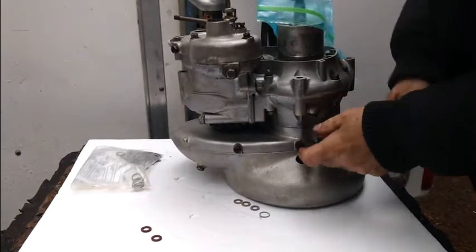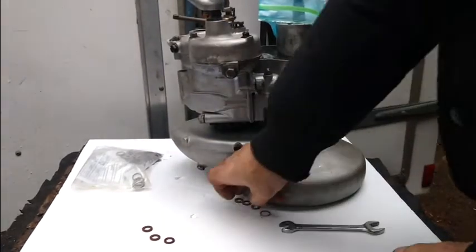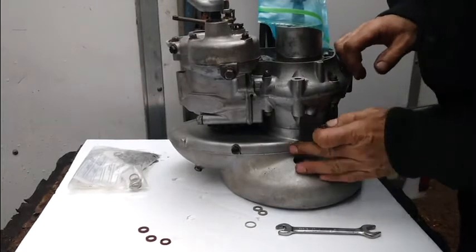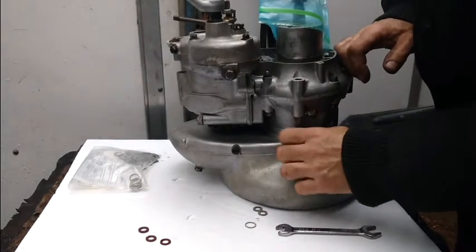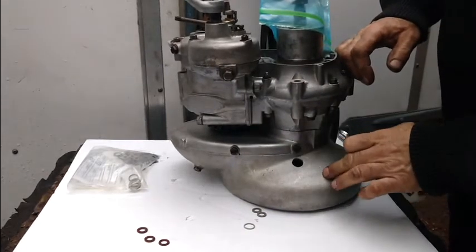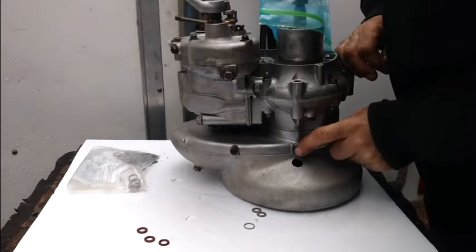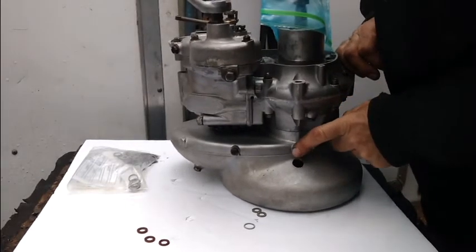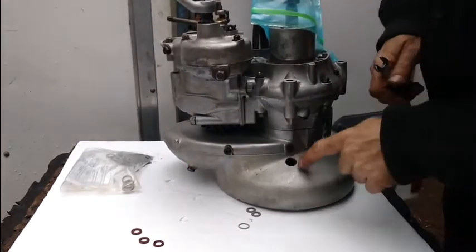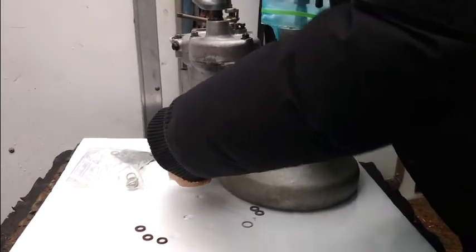Make sure those are fairly tight. Before this engine is run — actually when it goes back on the stand — I can put some oil in the transmission. This is the outer chain case; it's not installed permanently yet. When it's installed and we know we're going to leave it on, I can then add some oil to the chain case. The oil sits in this section of the chain case, and there's a vent hole in behind the fan.